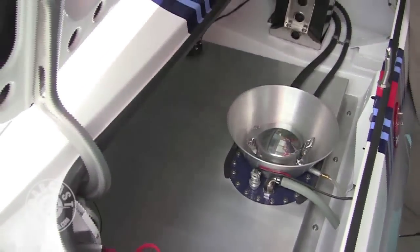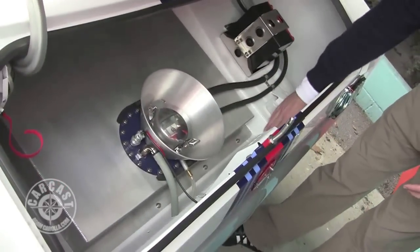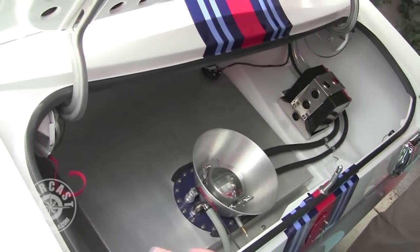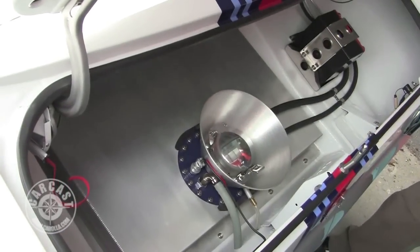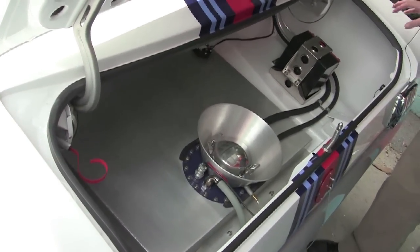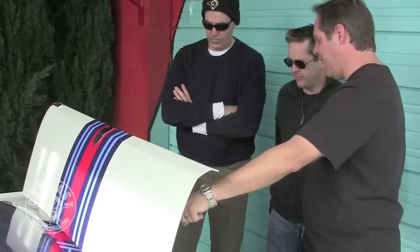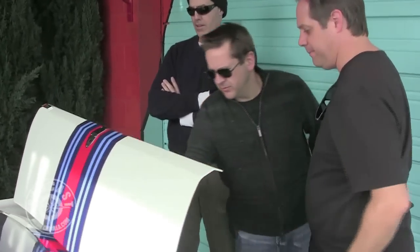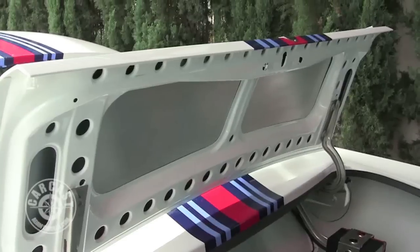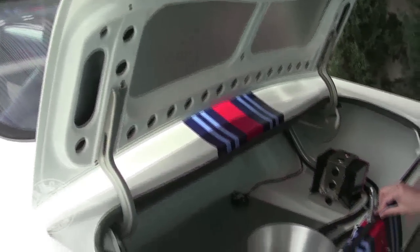It's the Shelby R style — I love this look. I love the Rhino liner crinkle paint with the white over the top. I always loved that part of race cars and did this on purpose instead of perfectly smoothing everything, because it absolutely ruined the look — it wouldn't look like a race car anymore. The car is skinned in some aluminum, some fiberglass — the whole nose is glass, bumpers are glass. This piece we thought it'd be fun to punch flare the frame and do an aluminum trunk deck blade. Your choice of fiberglass is to keep it period correct — not using Kevlar or carbon fiber because it wasn't around then. Even Euro spec tail lights.